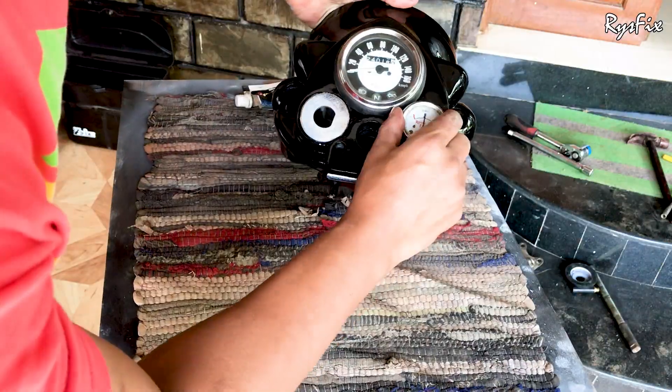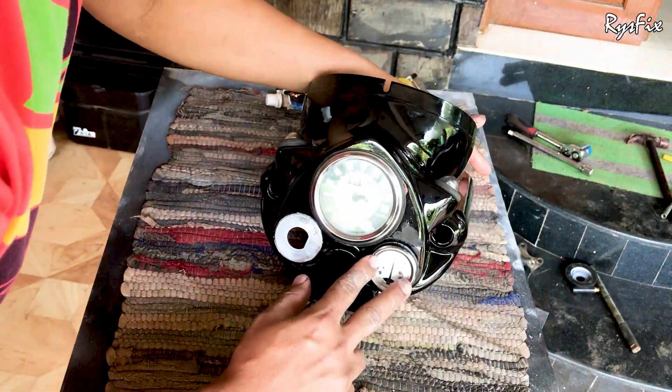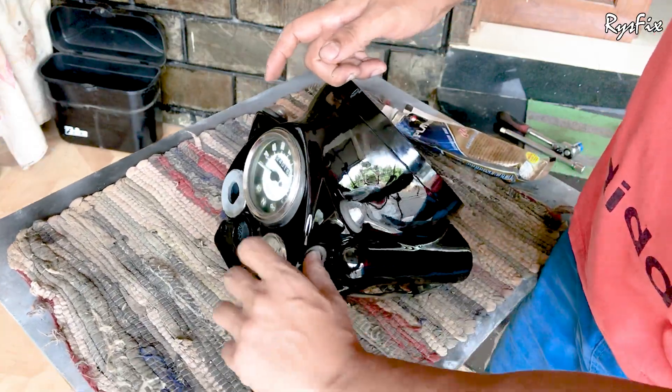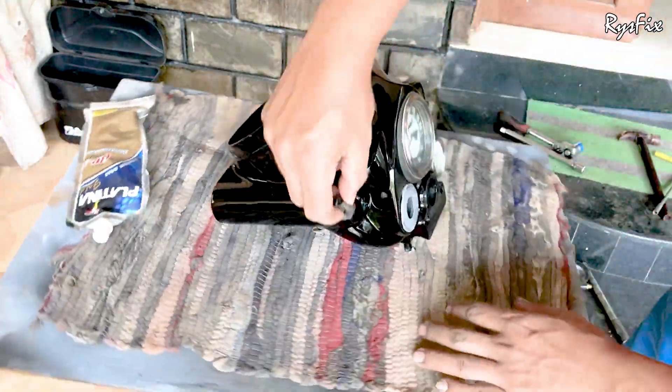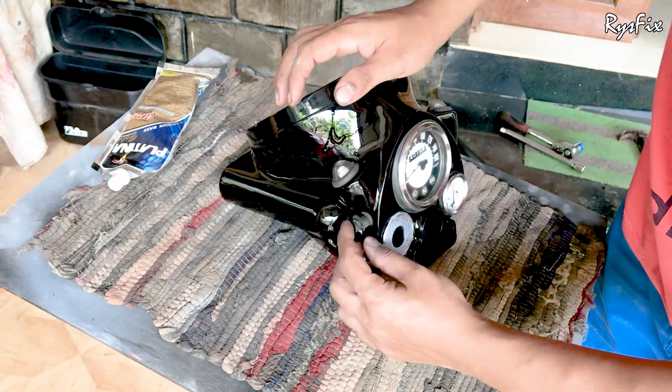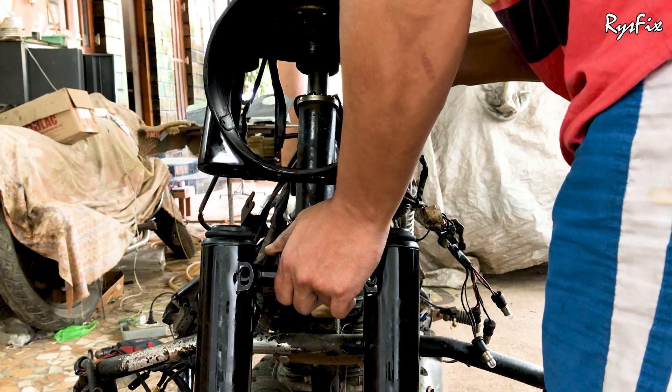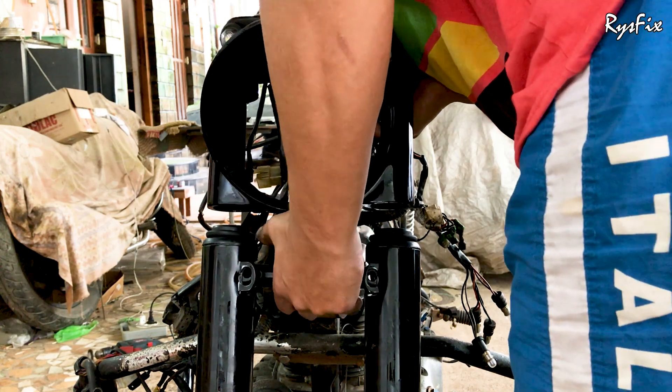Put the amp meter in position and push it inside — and there it goes in place. Then take the two rubber packings for the holes where your cables and wire harness enter the casing, and put them back on both sides. Once those are in place, position the casing on top of the bike and slide the fork and shock assembly inside the casing.